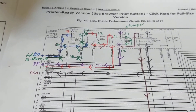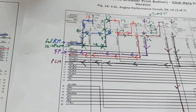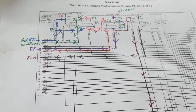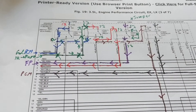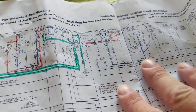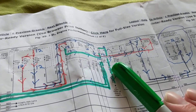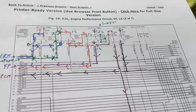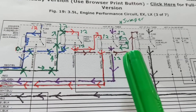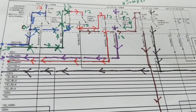Hello again. I was asked by a viewer — I believe the name was Nadir — to go over a schematic for a Honda Odyssey for a fuel pump problem. This is for a Honda EX/LX 2008. The fuel pump schematic is one of the most difficult schematics to analyze. I once made a video about the Toyota Camry — it falls in the same category, sometimes three or four relays until you get to the pump. Same idea for Honda, interchangeable for CRV and similar vehicles. You would not know which is the main relay just by looking at the fuse panel cover.